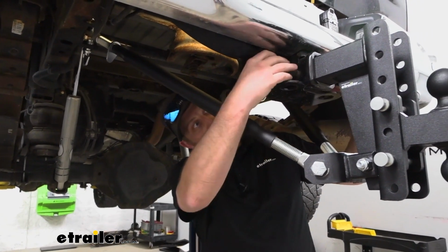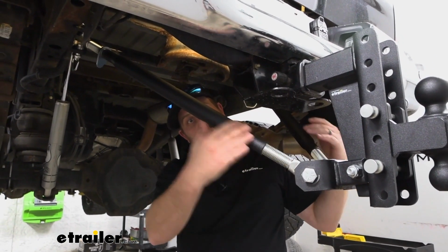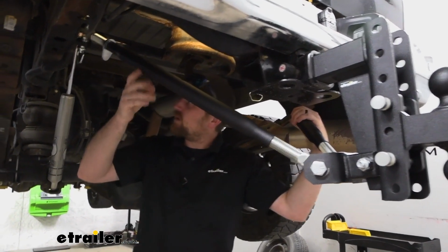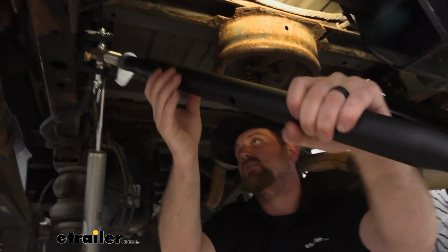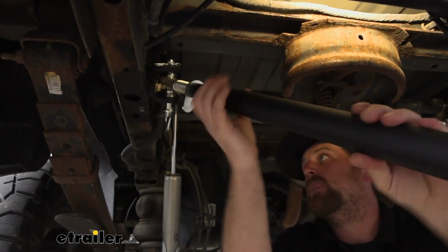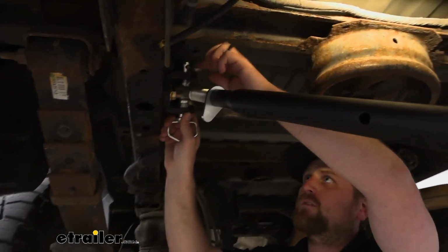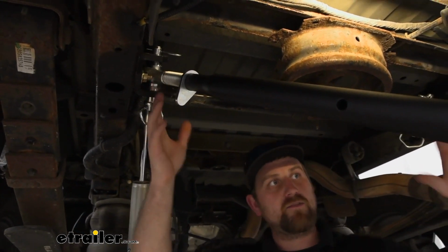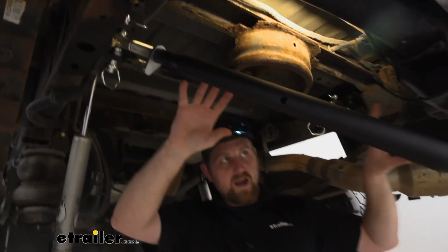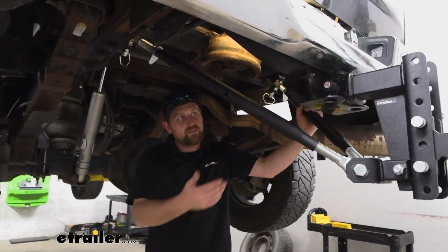So you'll take out your pin and clip up here, and then if you come up to your stabilizer bars at the attachment points and make sure everything's loose, there's these quick connect pins, right? So you can pull this out and pull this out, and this will separate. Obviously you do that on the other side, and then this whole entire deal comes out as one package there. So you still can get to your hitch.